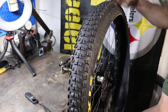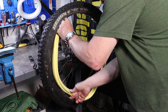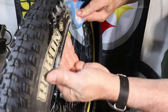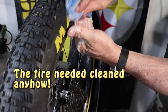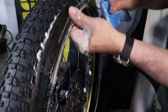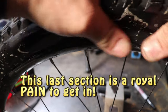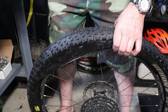I put the tire halfway on as the instructions state and then I tucked the insert under the tire. It pays to use every trick in the book for installing a stubborn tire because they are very challenging to get the second bead on the rim. I started off by applying soapy water with a sponge to lubricate the bead surfaces — some folks like to go in dry, but this would just add to the challenge. I find it easier to take everything to the floor opposed to using the wheel holder on my bench.